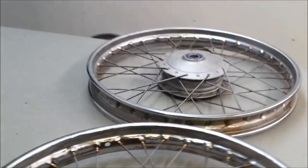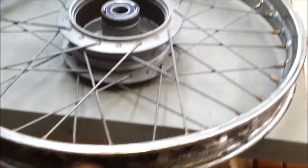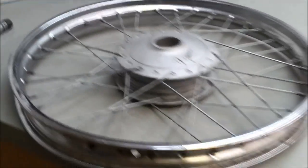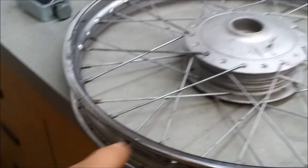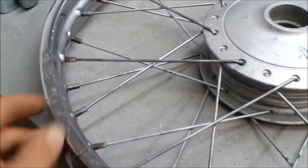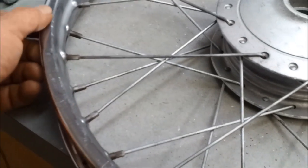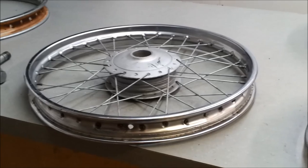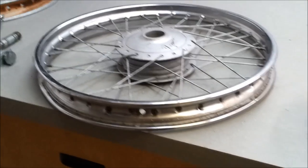These rims are ready to put tires, tubes, and rim strips on. They're basically already cleaned up. These are all rims I found at a salvage yard and the chrome is all rough, but I think ultimately I'm going to have these powder coated and that will take care of that. I wanted to show you something on this one rim — this rim has the appearance of being a pretty good rim, but under closer inspection the side wall is all smashed in. I don't know of any way to repair that, so you want to avoid rims that are dented like that. They can be a little out of round or out of true — you can tighten the spokes and true it up — but when this kind of damage happens, I'd avoid that rim.